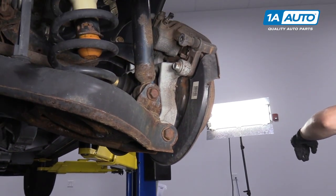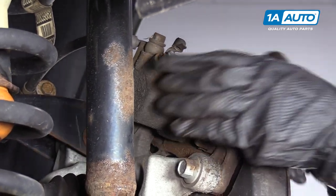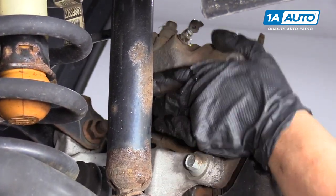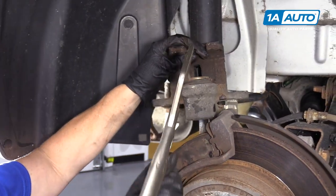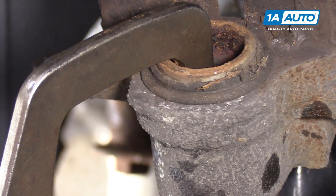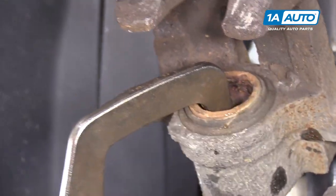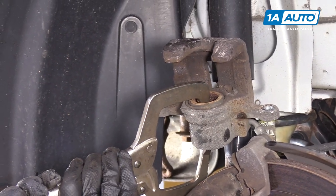Use a catch basin to catch your brake fluid. Use a screwdriver or pry bar to slide this caliper right out. I use a pair of welder's clamps that I like to put inside the piston and I just give it a slight squeeze until that piston bottoms out. This also gives me a chance to do a quick visual on the caliper piston boot — I'm looking for any tears or leakage. If you were to find them, you would have to replace the caliper. This is also a good way to test that it's not a seized caliper piston.